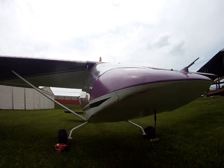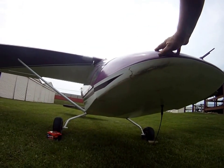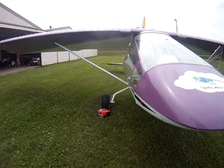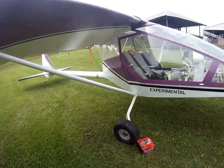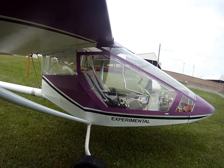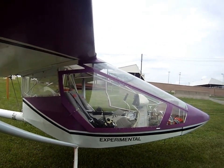People were worried about the damage — I'm going to show you. See this little bit of road rash right here? This is real thin fiberglass. He bounced his nose a little bit, hit the wheel gear, and hit that right wing tip. He fixed it. By the way, those are the heavier, later-design landing gear and you can see they're a little bit forward. The earlier design was straight underneath the strut and was a little nose heavy — people put too much fuel on and it pushed the nose over. So they moved the center of gravity back by moving the wheels forward a little bit.